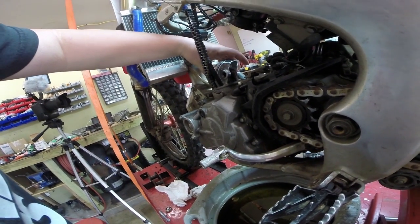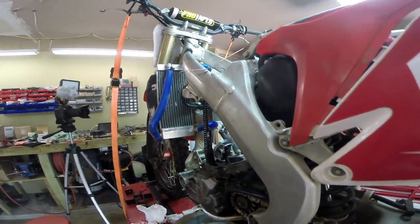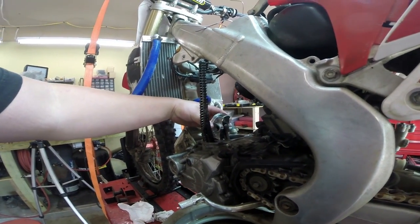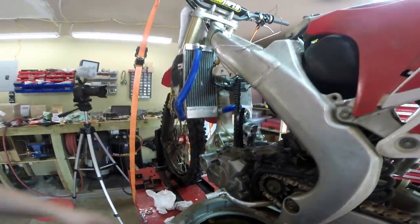This Wiseco high performance piston bounces back and forth side to side, and I had never seen that design before. So I actually called up Wiseco earlier today and asked if I was supposed to have some sort of spacers. They said no — it makes sense because there's no up and down play, and side to side play doesn't really come into effect because you've got the jug on. Part of the reason I do business with companies like Wiseco is Monday through Friday 9 to 5 you can call them, they'll put you through to a tech guy right away who will look up the specs, answer all your questions, walk you through measurements, and help with installation questions. That versus buying cheap Chinese pistons with no idea if the thing is right — really makes a huge difference.